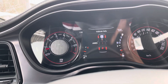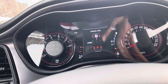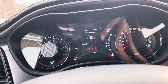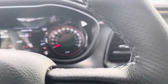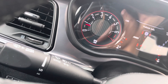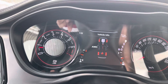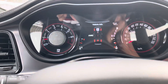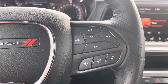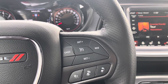The second thing is if the car skids — if the car skids it's going to go to all-wheel drive. The last thing is the wipers. When you turn the wipers on, it automatically goes to all-wheel drive. When the wipers are off, it will go back to rear-wheel drive. So this is how the all-wheel drive system turns on and off.